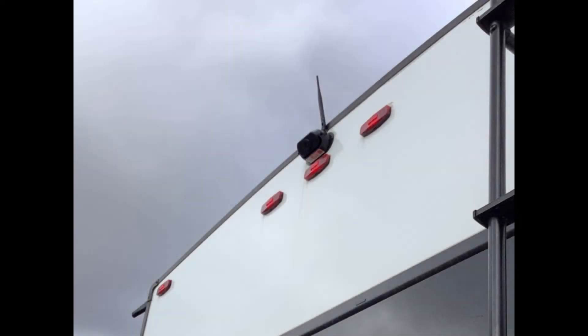The Wi-Fi signal coming from this camera is mediocre at best. If you're having trouble connecting, check the Wi-Fi signal on the device that you're attempting to connect. You should have probably a minimum of two bars in order to establish a good connection. When checking for signal strength, I turn on the sound from the camera and walk around the RV. As soon as the sound starts to cut out, I know I've reached the maximum distance for connectivity. At that point, I'll go back and mess with that antenna until I can get the most distance out of this camera.